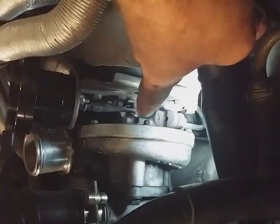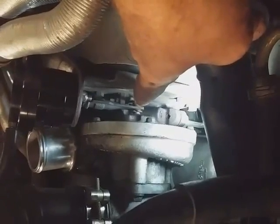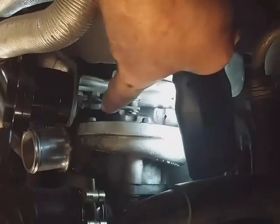If you wanted to test this, once you start the car the arm is always in the up position when it starts. So that's the position our actuator needs to start from. This is probably the biggest mistake people have made — not winding the arm up finger tight against the stopper screw just there.